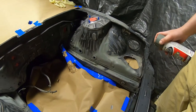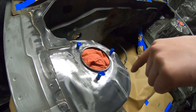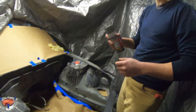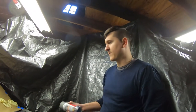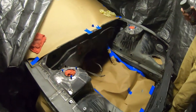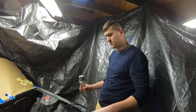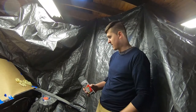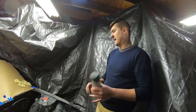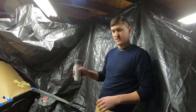We sanded down the engine bay again with scuff pads. I went over a few more spots like the strut towers - we took the nuts off, jacked up the car so the studs would lower, and got all around there because there was a little bit of surface rust. We got around the whole engine bay a good amount of times, then started prepping with tape, masking paper, and our homemade paint booth - a little ghetto but it'll work. Today I'm gonna lay down self-etching primer on the whole engine bay and core support, then probably tomorrow I'll do the filler primer.